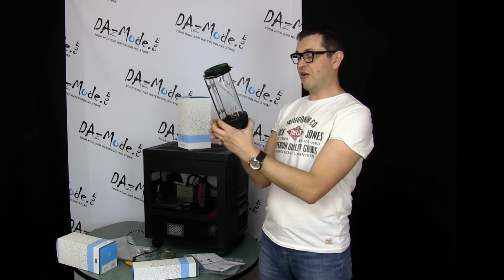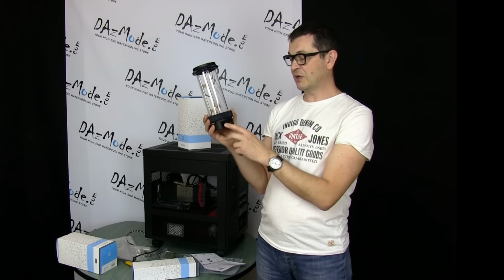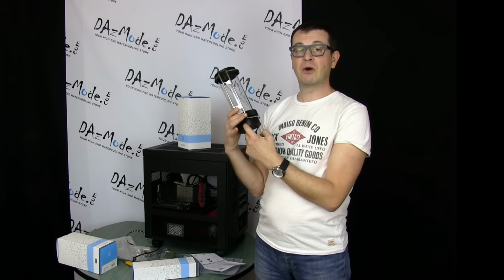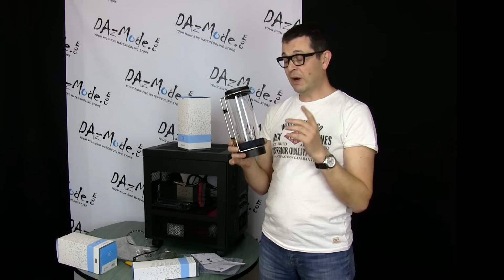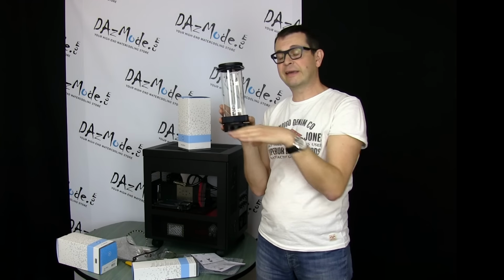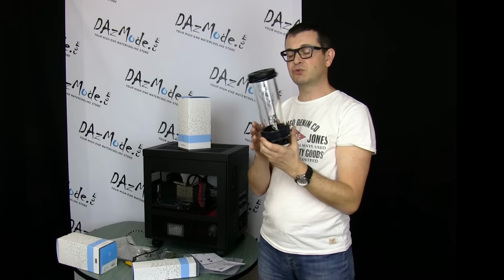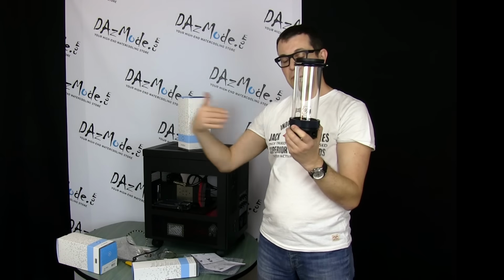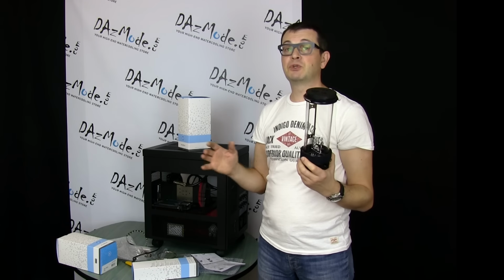So now we can have ports coming from here in a more or less traditional way for EK. We have 2 ports together on the side and 2 ports on the bottom. But now we have 1 extra totally in the opposite direction. That's actually a pretty clever idea. Why? Because you don't always want to run tube across the entire case and show how it's coming to the reservoir. For anybody who wants to do a discreet type of build and hide tubing, you can run, let's say, black tube behind, connected in the back, and it won't be visible if that's what you desire.